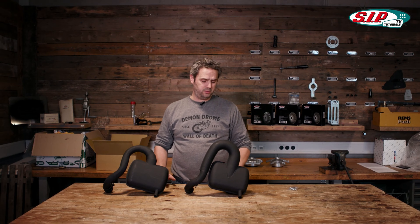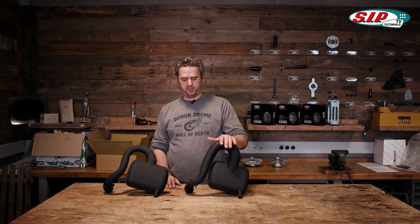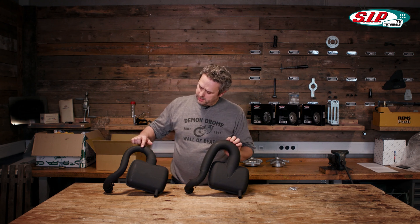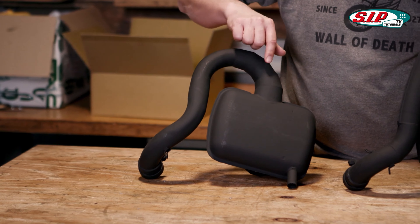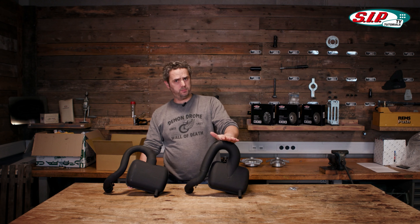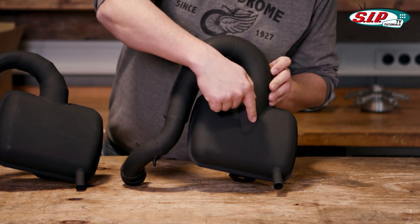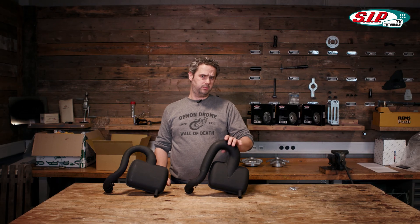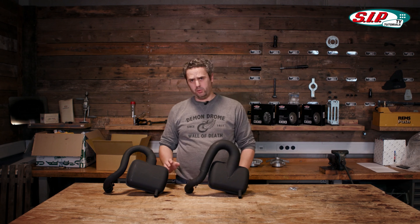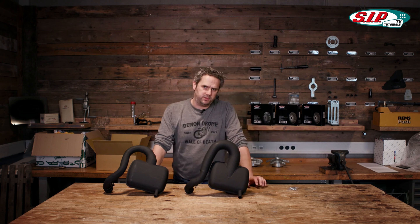To fulfill all requirements we had to think of entirely new methods of manufacturing the elbow. As you can see, the manifold on the Zip Road 2.0 is manufactured from individual segments, whereas on our new Zip Road 3.0 the manifold is deep drawn. This has several advantages. First, we can guarantee that the manifold is exactly the same for each exhaust pipe. Second, we were able to achieve a tighter radius without performance losses in that area, and that is also how we gained space for mounting. Third, this elbow has no welding seams that would get in the way of the exhaust gas flow.